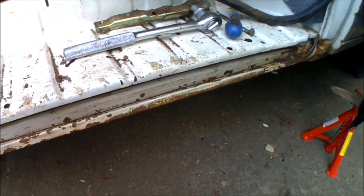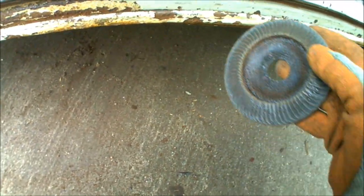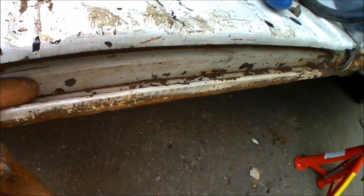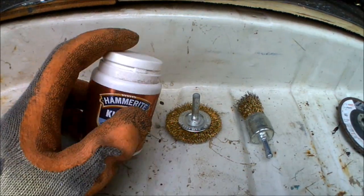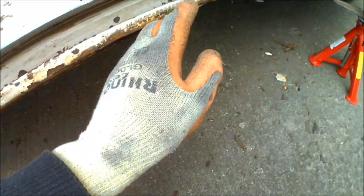The vast majority of the surface rust has been removed with the wire brush. There are still a few bits I want to tidy up, but I don't really want to be cutting or heating into the metal, so I'm going to use just a flap disc for the grinder. They're quite forgiving discs — they won't just grind straight into the metal; they're just for taking off the surface material. I've already done inside all the way along the channel with the steel brush and that's cleaned it out really nicely — the vast majority of the surface rust in the actual channel itself is all gone.